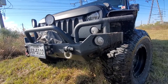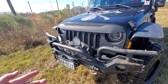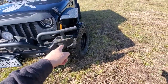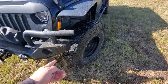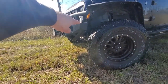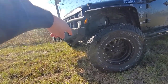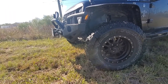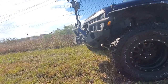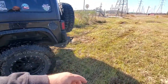The reduced weight would have the effect of giving me a bigger lift because it wouldn't sag the front end down as much. This little bit that sticks over — I like the way it looks, but it limits my approach angle a little bit. Without it, my tire could grab onto a little bit more. It probably doesn't come into play that often, but it doesn't serve a purpose and it's weight, so I wouldn't do that again even though I like the look of it.